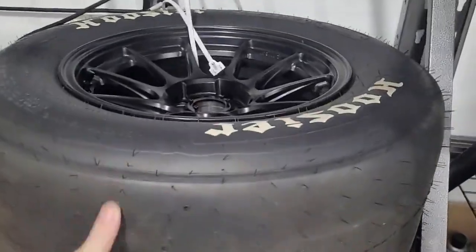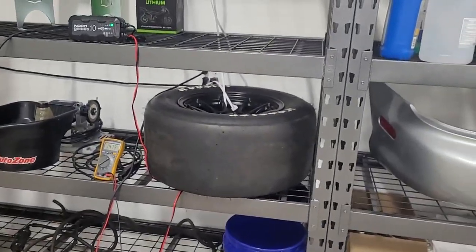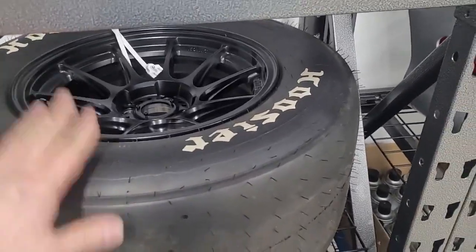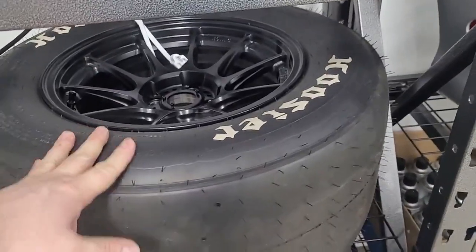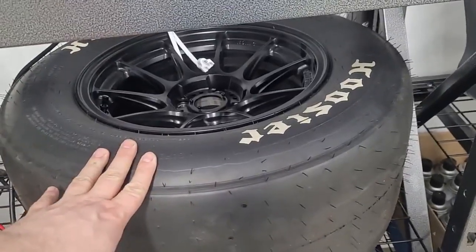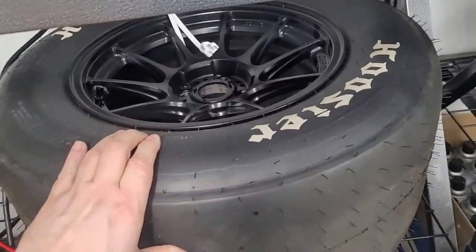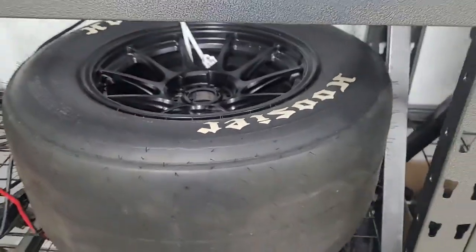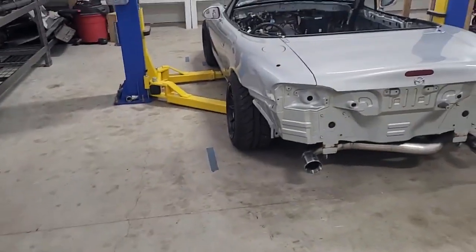These are street tires, but we also got our slicks - this is a 26-inch tall tire with a 10-inch tread section, almost a foot wide. We're doing this for grip. We're going to have some sidewall flex finally. With these being ten inches wide instead of six, I used to have to air down to 18 psi and the car would launch hard but be all over the place. I'm betting with these I can probably air down to like 14 psi and get some real flex out of these sidewalls for better grip.